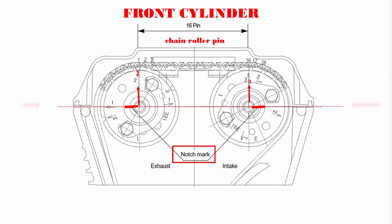Step 2: For the exhaust camshaft sprocket, it has mark number 2. This number 2 must always be facing 100% accurately upwards — that is, straight vertical.